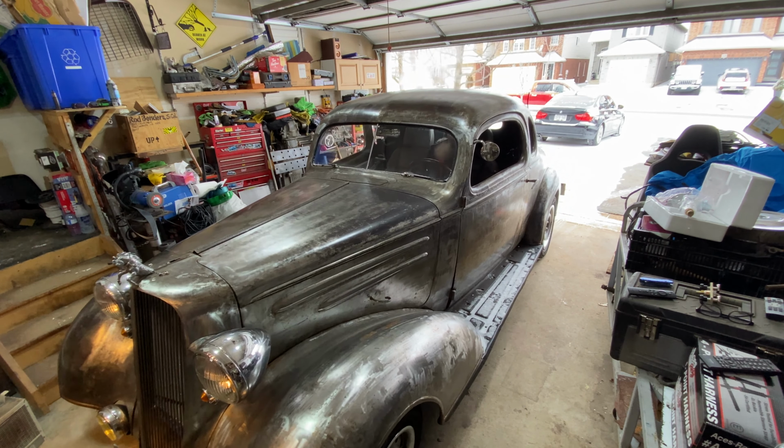I didn't take my timing light. But I think I'll wait for the warmer weather, to be honest. Well, maybe not the warmer weather, but maybe not the minus 20 degrees we've got at the moment. Give that a few more minutes, see how it revs. But I noticed there when I put it into reverse, the revs didn't drop as much as they did with the last distributor. Considering it's not really warmed up yet, that's a good sign. I don't think the mechanical advance was working on the old distributor. And I don't have snow tires, so I really don't want to take it out in the snow. I don't want to risk poor Bugsy. Pretty good though.